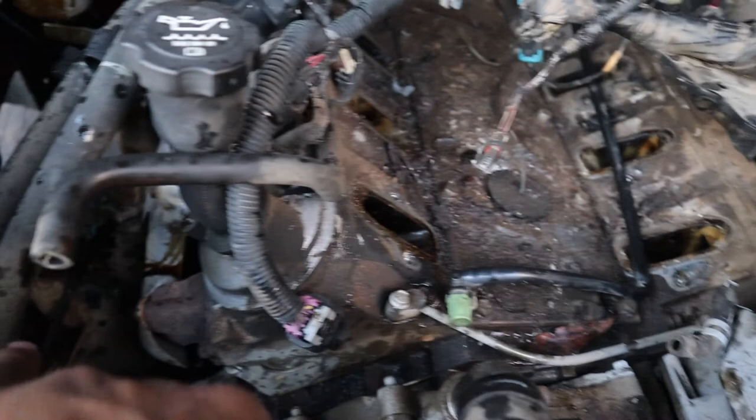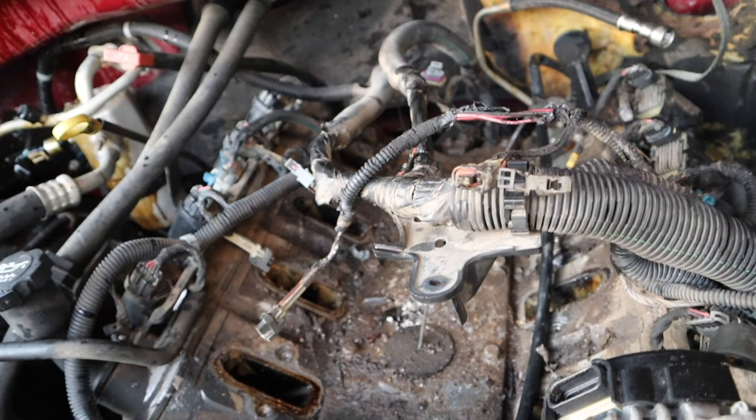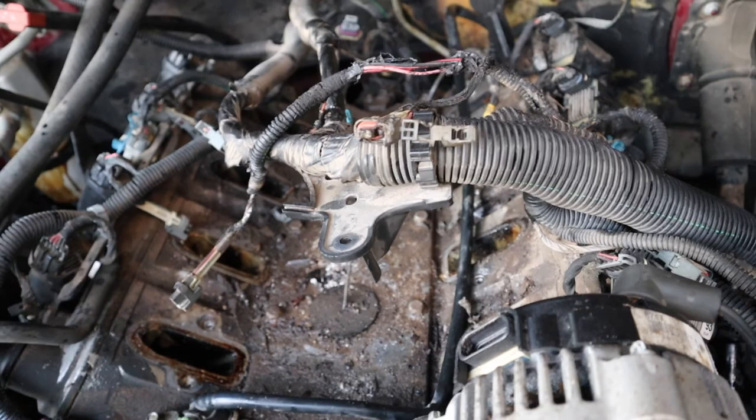If the spark plugs would have still been on, I probably would have bent a rod or something, because all the water was going to look for a way out and there was going to be no way out. All the compression could have bent a rod or something. But luckily nothing happened, nobody got hurt. And all this stuff I'll just fix tomorrow.